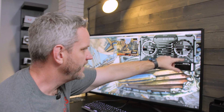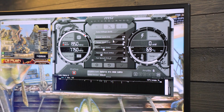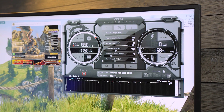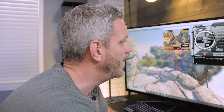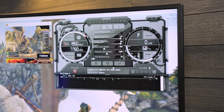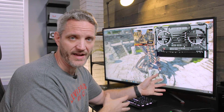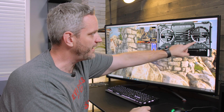It looks like our temperature maxed out at about 69. 53% is where we went on the fan speed. Now here's what we're going to do — we are going to see how much we can truly impact this. Core clock: 100. Memory clock: 500. I almost tried to overclock it by a whole gigahertz — that'd be awesome but it's not possible, not with this cooling setup. We're also going to take our fan speed out of auto and drop it all the way down to the minimum, which is 25%.